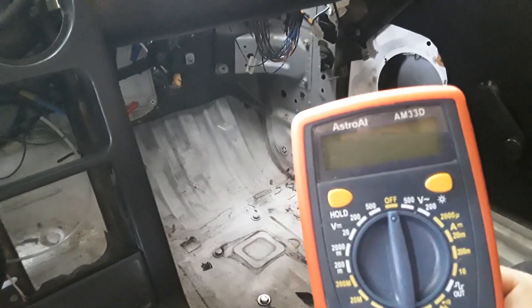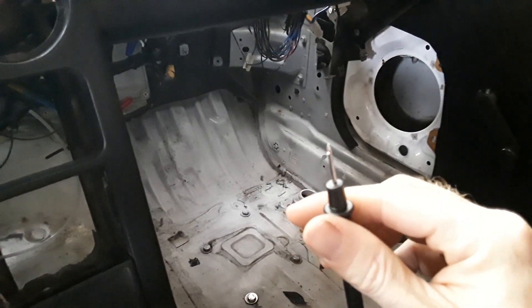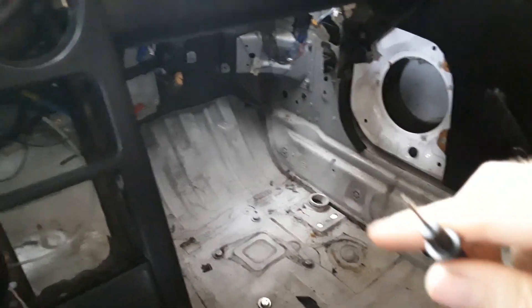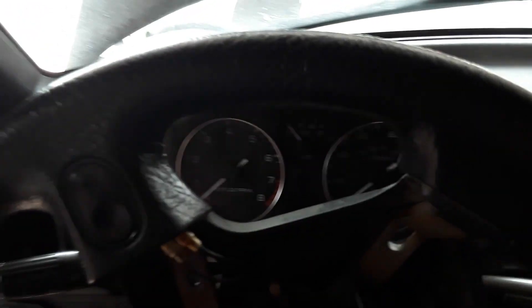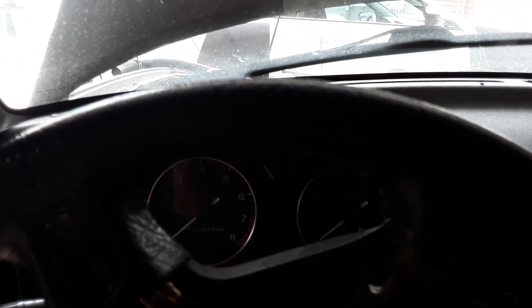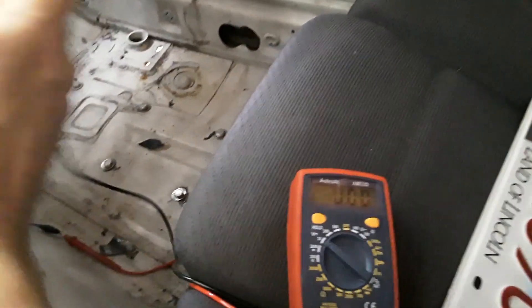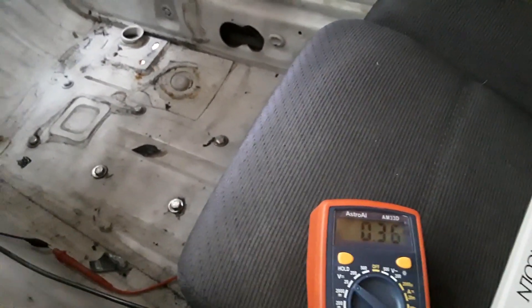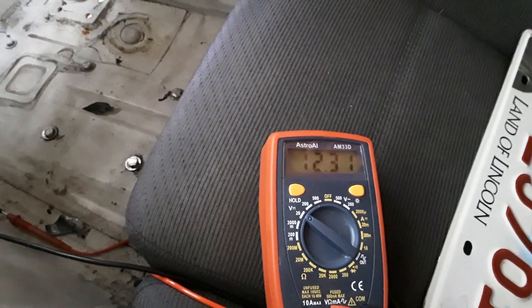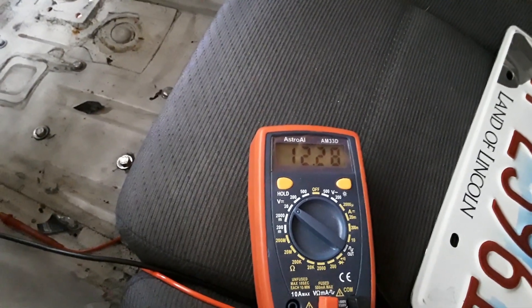I have a voltmeter set up with two leads — one already attached to the wire. Let me show you that when we turn the key to the on position, hopefully we have 12 volts, and when we turn it off, nothing. The key is in but not in ignition or accessory, and the digital multimeter is reading zero. Turning the car to the accessory stage — this still reads zero. Now taking my ground lead to complete the circuit — we're getting about 12 volts, which means this wire will work for us.